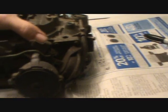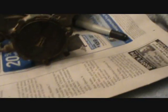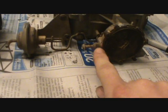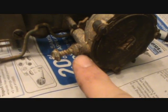Let's take another carburetor that I have here and disassemble this and let you see what's in here. Now this is the same kind of choke. This is a hot air choke. You can always tell a hot air choke because it has a threaded connection. Can you see this here? This one has it. It's got an orifice in it.